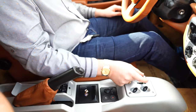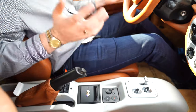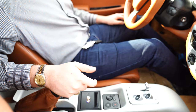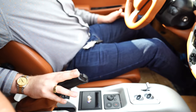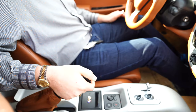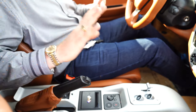This little toggle is for your reverse — you lift it up and pull it towards you and that will put the car in reverse. You wait until the car beeps and then you're in reverse. You also have your handbrake. It's important that when you park the car you pull the handbrake. You can park the car in gear or in neutral, but I recommend, just like a manual transmission car, if you're going to park it, pull the handbrake. It's also a common myth that you just yank it as hard as you can. You actually want to lift it up until you feel decent resistance and can feel that the car isn't going to roll — it doesn't necessarily need to be pulled as tight as you can, or you're going to stress out the Bowden cables.